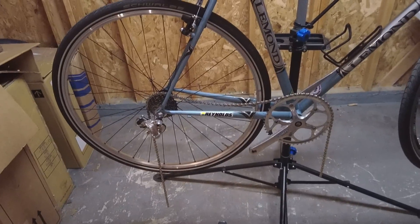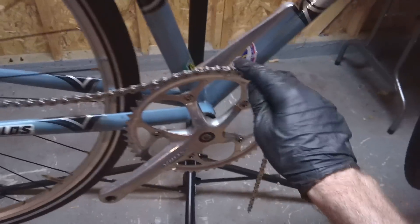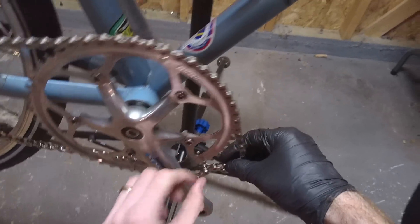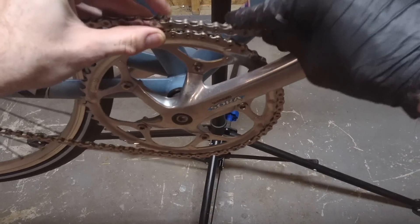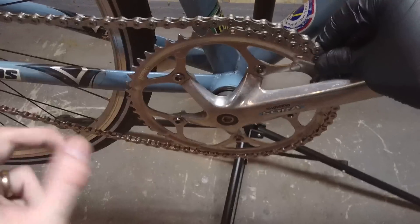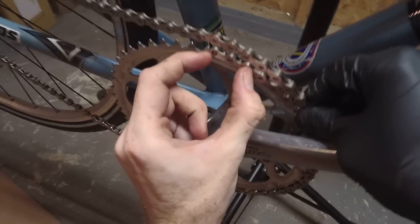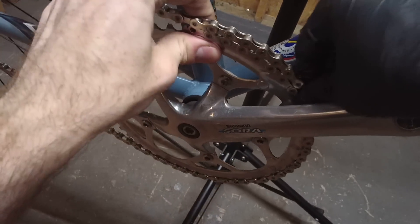What chain length do I need for this bicycle? There's a quick way to figure it out — not always perfect, but a good starting point. Wrap the chain around the big chain ring and the big cog in the back, then bring it up to the big chain ring in the front and see where the chain overlaps. If it overlaps by one link or more, the chain is long enough. If it doesn't, it's too short. One link is an inner plate and an outer plate, each plate being a half link. So I want it to overlap on the big chain ring in the front and the big cog in the back by one full chain link or more.